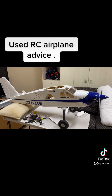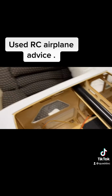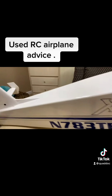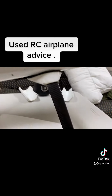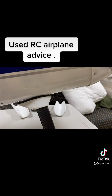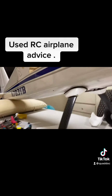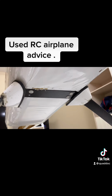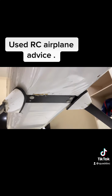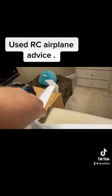But anyway, when I first get a used airplane, I just look around and look inside for broken braces. A good thing to do on the surface is look for covering repairs. So what do you know? There's landing gear and there's some covering repair, which usually means it's had damage to the landing gear. Sure enough, if you look underneath, you can see there's stuff going on under there, and one of the nylon screws has been sheared off, so I guess I'll drill that out and get it out. But when you see one thing wrong, you should look for other things.